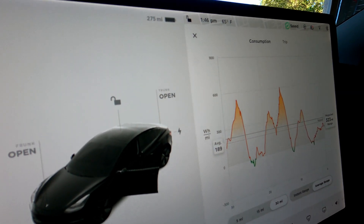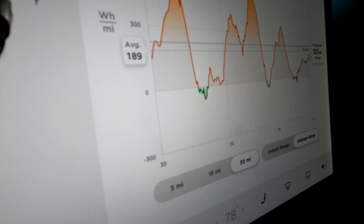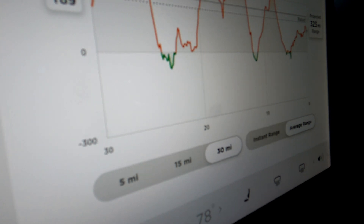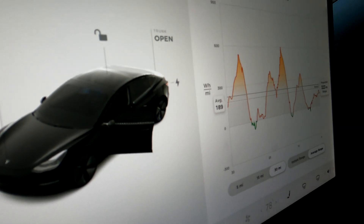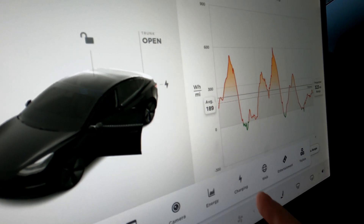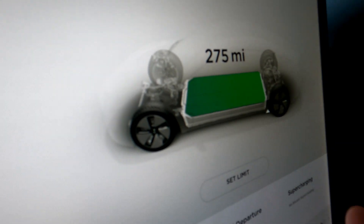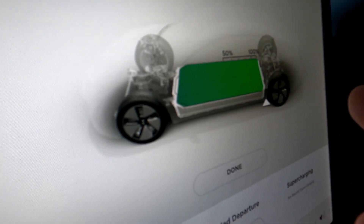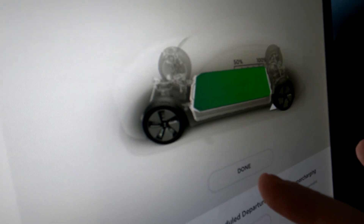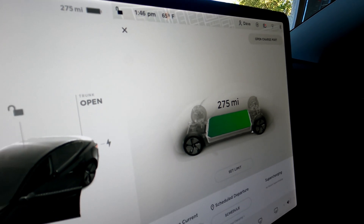Let's pull up the battery. This will give you a calculation in real-world time based on the mileage — you can go 5, 15, and 30. You can also do instant range or average range. So we're at 275 on a full charge. One thing about the LFP is you won't ever see that trip anymore, and as soon as you put it past 90%, you're not going to get any errors. This battery is meant to charge up to 100%. This is probably about my 15th charge up to 100%, and it's doing great.